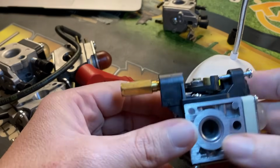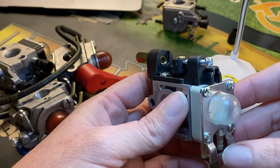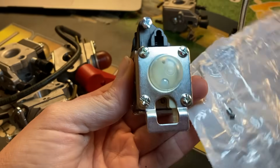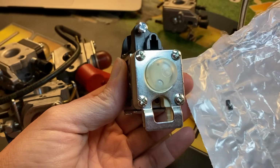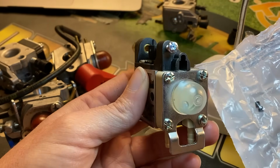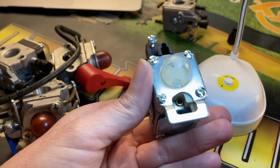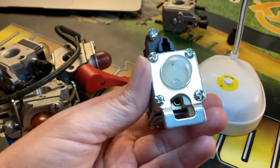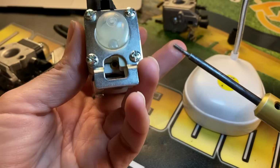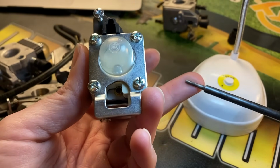Now the only one that's a little tricky, where you can't really tell where they are, and there are multiple videos on this that you've probably seen already, is this brand new Echo carburetor. When you get a brand new one, limiter caps are not installed yet, so you don't have to worry about it. But if it's a brand new OEM carburetor, you're not gonna have to adjust it anyways. But if it is on the machine already and you go to adjust it, you will have those limiter caps inside of there. And the only actual way to get those out is with a special tool from Echo. I will put a link in the description box below if I can find one that they sell online.